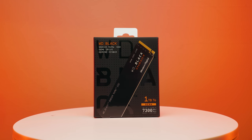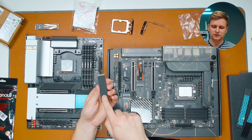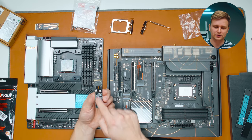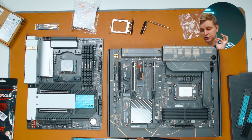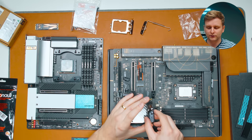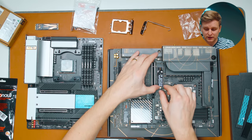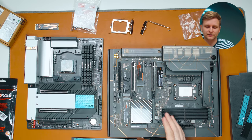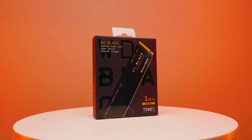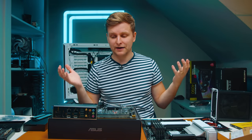For the OS drive I upgraded to the Western Digital Black SN850X. It's a top-end drive — all the NAND and controllers are on the top side, nothing on the bottom. This and the Samsung 990 Pro are among the fastest drives for OS and programs in terms of random read and write speeds. Sequential speeds are super fast as well. I wanted something super snappy for the OS and programs since that's what we'll use every single day.